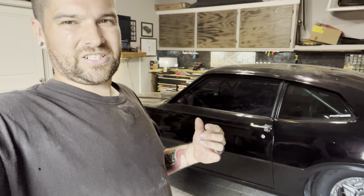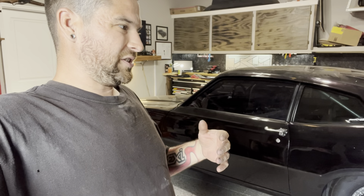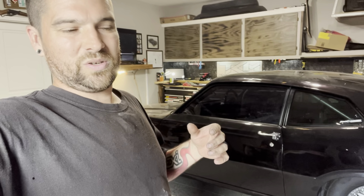There's a small percentage that there still may be a leak here or there. So I told her that I wasn't trying to get it 100%. Basically, when I spin the wheel, every single wheel stops, so we have caliper engagement on every single wheel. When me and Mike nut and bolt the car, we will then bleed it one more time with me pumping it this time, because she knows kind of what it's supposed to feel like, but obviously these are manual brakes that are a little different than what she's used to. They're probably different than what I'm used to.